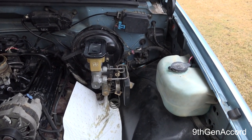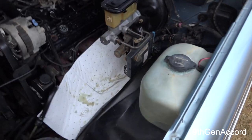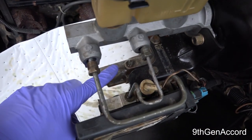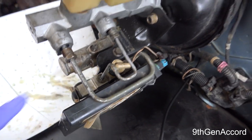What I'm going to be doing is basically returning this to the state of no anti-lock brakes. This only has rear wheel anti-lock brakes, and you can tell because it's got the Kelsey Hayes computer here. This right here is the dump valve, this is the master cylinder, and this is the proportioning valve.